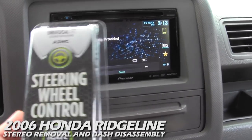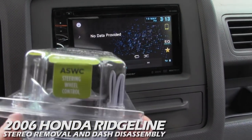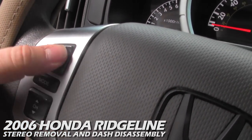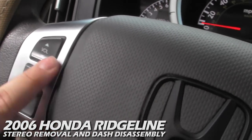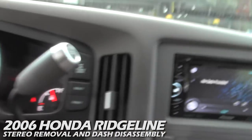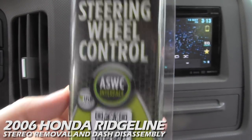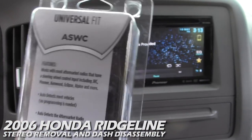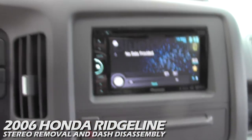The first thing you need to do is purchase a steering wheel control interface. One of the problems with installing this radio was I lost functionality on my steering wheel — none of the volume buttons or switches over here work, which I really liked to use. Supposedly the ASWC interface by Axxess is supposed to handle bridging the compatibility between the steering wheel controls and the head unit, so that's the first thing we're going to do.